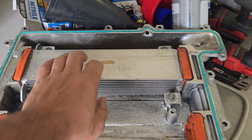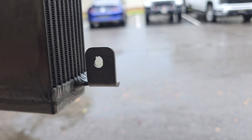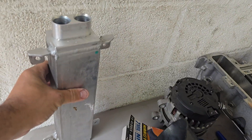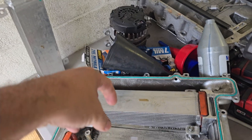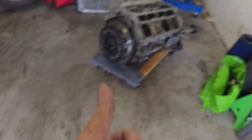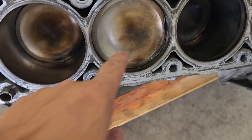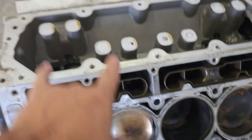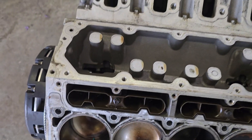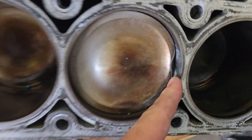Now that we've determined this brick is leaking, I can only assume this one is also leaking. The fact that I can still grab it and turn it even after soaking - yeah, so that could be the smoking gun. Meaning it was sucking coolant out of it, that's why it smelled like coolant - high IAT because of lack of coolant, high IAT, water, oil, E85, Sunoco 260, and a bad combustion event. See how clean this one is as opposed to these two - the back of the brick makes sense that it was happening down here near the supercharger.